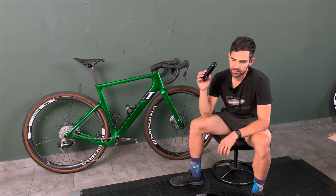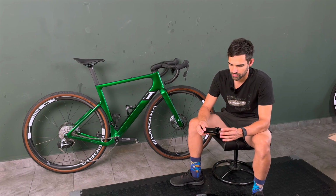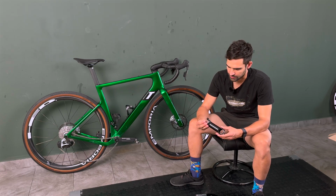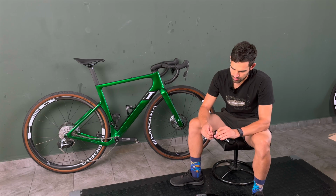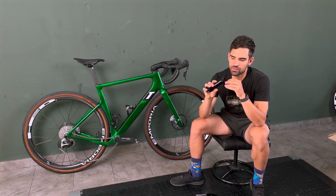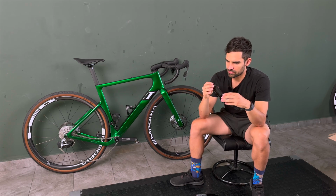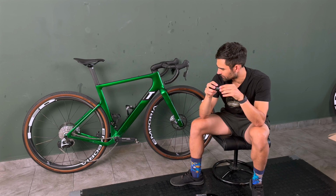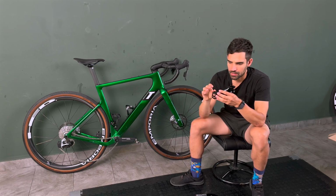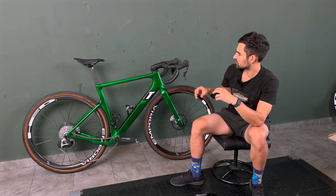The reason why this is so lightweight is partly that it uses a minimal amount of material and super high tolerances, and the stem bolts are all made out of titanium and are just M4s, so really tiny screws. The tightening torques are really minimal, 2 Newton meters at the clamps. With that handlebar, tolerance stacking is usually a problem with bike parts. Even with the proper torque and friction paste, there was slippage in the bar clamp.